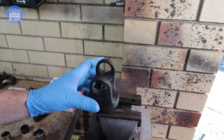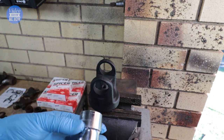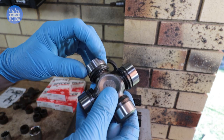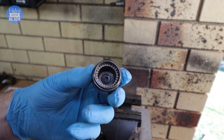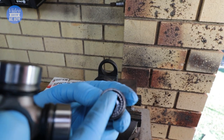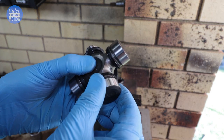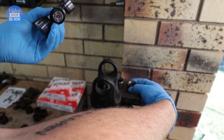The first part is sitting your yoke into a vice — or you can even do this on the ground. If you're doing it on the ground you just need an extra socket to act as a catcher over the top so that you're banging it through; I'll show you that part later. Obviously if you've got a vice it's the way to go. With your new universal joint, carefully remove the end caps from one side — you can see all our brand new roller bearings in there. If any of them do fall, just get a flathead screwdriver and push them back into place. Be really careful not to contaminate any of the new grease. Pop that to the side, then do the same on the opposite side — carefully twist that out, double check everything is good, and pop that to the side too.